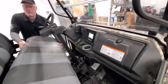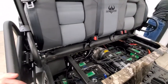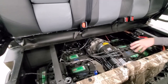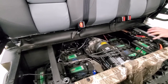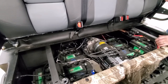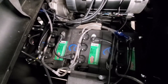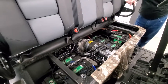I'm going to pop the seat out and take a look at the motor in here — and I do say motor instead of engine because it is an electric motor: a 48-volt brushless inline AC motor. You can see all the battery packs. These batteries are Interstate batteries, so they're easy to come by. Most local Interstate dealers actually stock these — it's not an odd or specialty battery. It's just a really good deep cycle battery that's been around a long time, built on a platform where you can get parts easily.